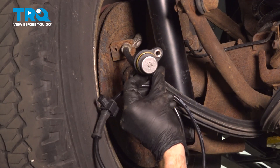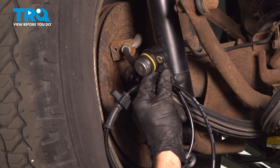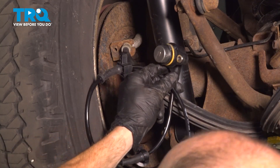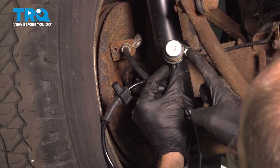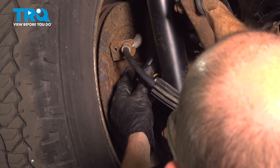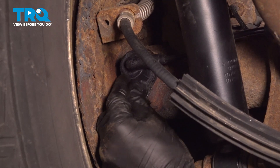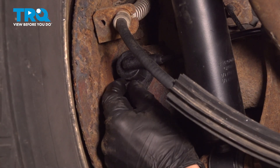Let's get ready for the installation of the brand new ABS sensor. On the sensor itself, you'll find a rubber O-ring making its way all the way around — that's important to seal it so no moisture gets into this area. To help install the sensor, apply a little bit of lubricant all the way around the O-ring. Once lubricated, slide it into the differential and align the mounting bolt hole. Press it in nice and easy, then install the mounting bolt, snug it up, and torque it to 115 inch-pounds.